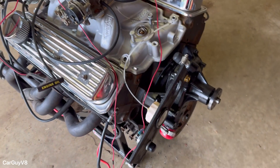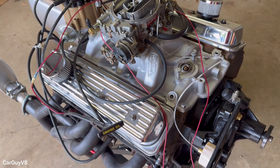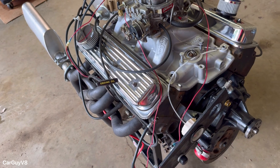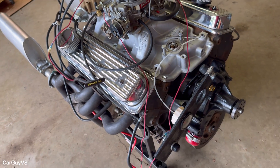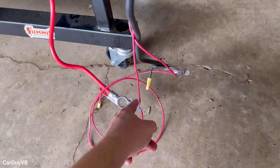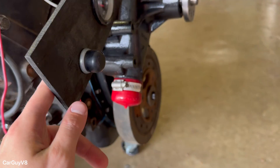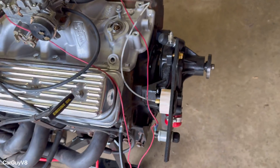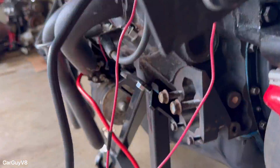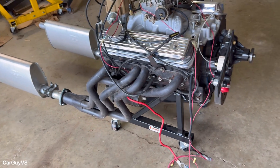Keep in mind this isn't an actual engine run stand and it's not a car, so you've got to route things so that they won't burn. It's wise to put a fusible link or a fuse in line in case a wire gets on the header and causes a short — last thing you want is for it to spark. The other wire coming down to the battery cable goes up to the push button starter right here. This super cheap push button starter works just fine, and it comes right down here to the starter solenoid. So just two wires — that's all it takes.